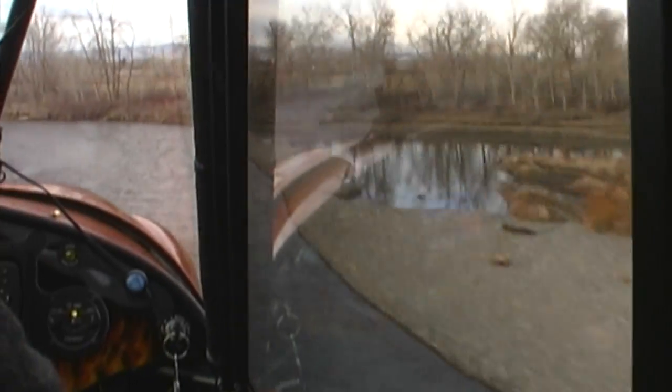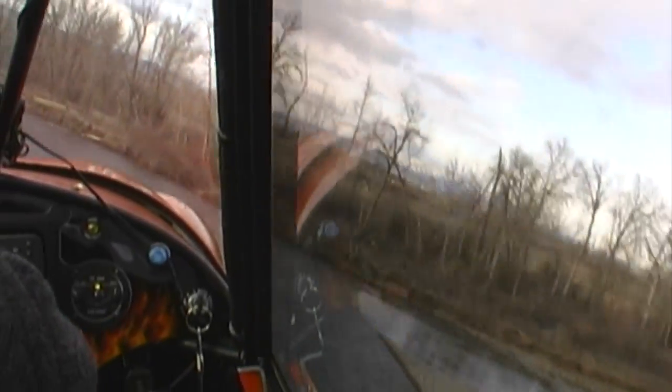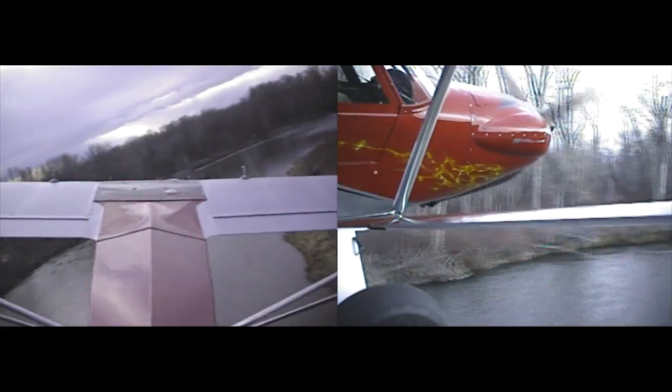Besides the gravity-repelling 180 horsepower engine, the airframe design has been tested to well beyond the requirements for light sport aircraft. Flight and landing loads were increased by 40% to 5.5 G's for the design loads and to 8.5 G's for ultimate tests. Piper Super Cubs were tested to 3.8 G's as required by the standard category.